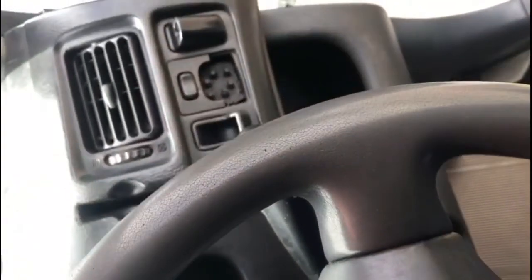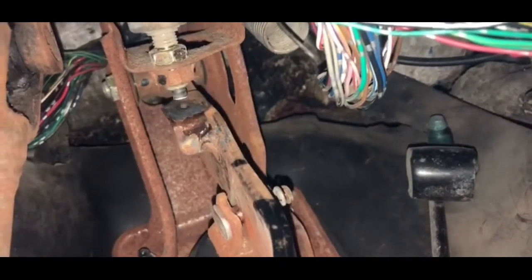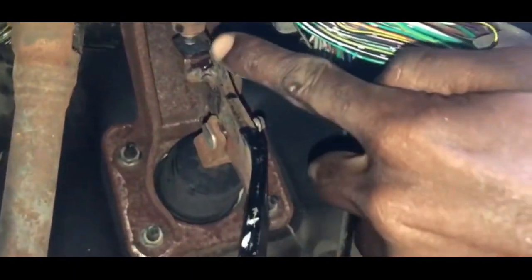When I check the light switch, it was off. So I decided to check the brake pedal area, where I would find the brake light switch. The brake light switch is a small component near the brake pedal responsible for activating your car's brake lights. Here is the brake pedal — there should be a small plastic piece used to engage the brake light switch, but you can see where I'm pointing, it is missing.